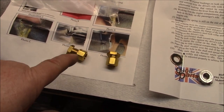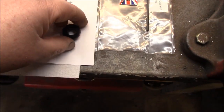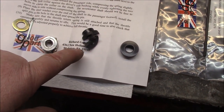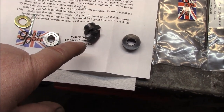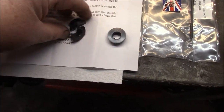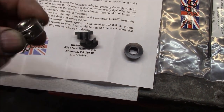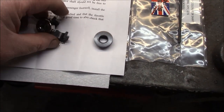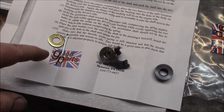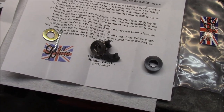The Good Parts kit has a nylatron-style bearing that goes into those reinforced holes — one for the driver's side, one for the passenger side. The reason these bearings are split is intentional: they can be replaced with the throttle shaft in situ. You put them in as a full bearing surface, then a locking collar — also in two pieces — locks the bearing in on the driver's side. You still have the flat washer and split pin on the passenger compartment footwell side to lock the shaft from moving side to side.